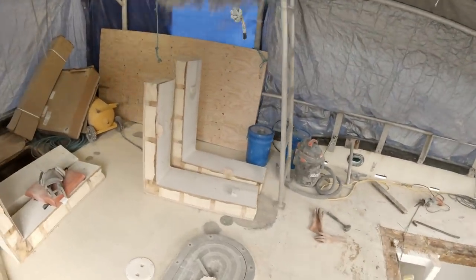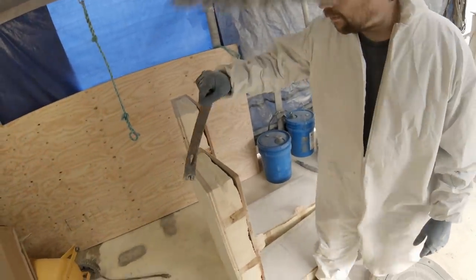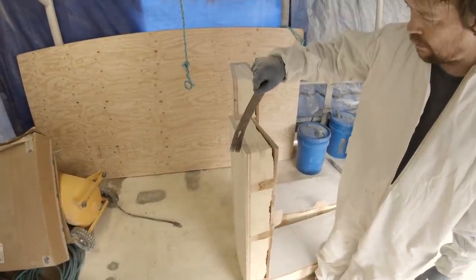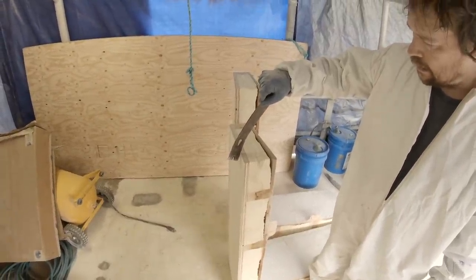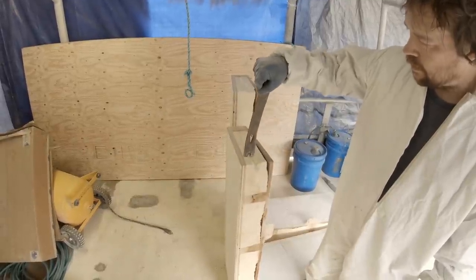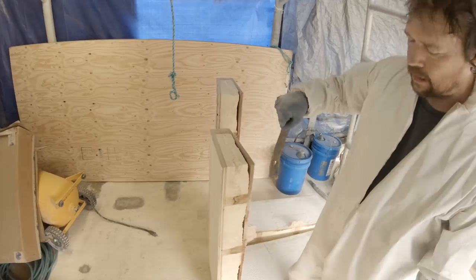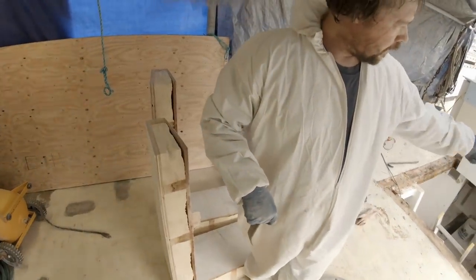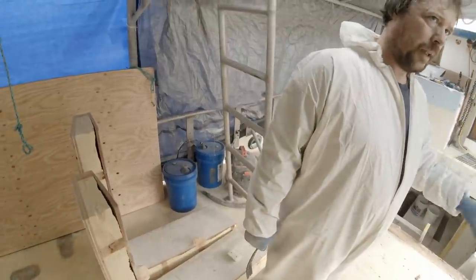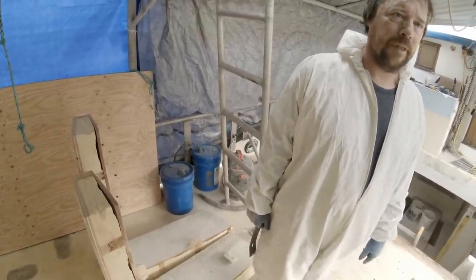So these are actually about the right length. In reality, we should be able to just trim the outside down and get the crown where we need it. Trim the 2x4, and then put in the new kind of sill plate in there. And then this can hang long down in and tie into the new beam. Then we'll maybe have to put a little strip in there at the bottom. I don't know, it's a little hard to envision right now.